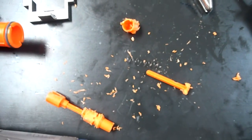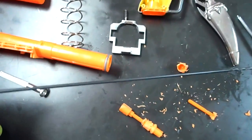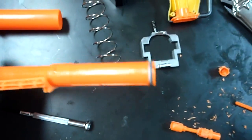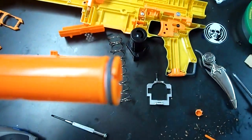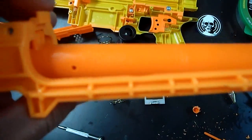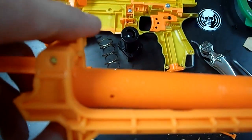The Alpha Trooper had a new style air restrictor in it that was really easy to take out. I've been told you can tap them out with hammers, but I went with my trusty Dremel bit that's really long, and that worked remarkably well. I just drilled out the two posts holding it into place, and you can see that I get a really clean shot through it. I like these new air restrictors a lot better. I've also Teflon taped the O-ring. I'm about to tape over the air release hole with E-tape, which is just as easy as using some sort of putty or epoxy, and I think it looks nicer when I'm done.